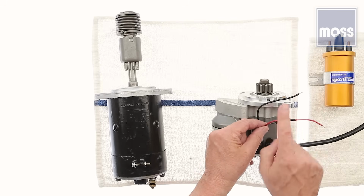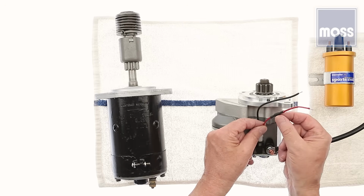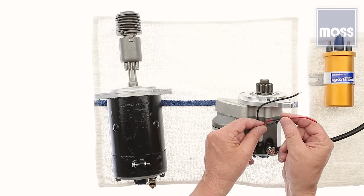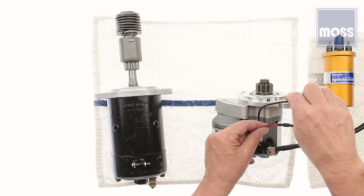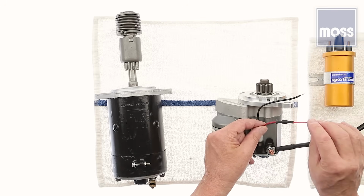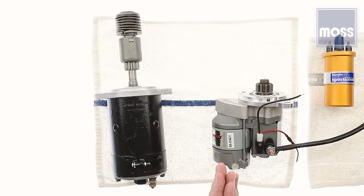It's easy. This is just a piece of wire. This piece of wire has a diode in the middle of it. The one with the diode is for the later model cars. So if you only have 1 wire coming down to feed it, feed this one. Take this one, tape the end off so she can't get in trouble, and just get her out of your way. You don't need to do anything with it.